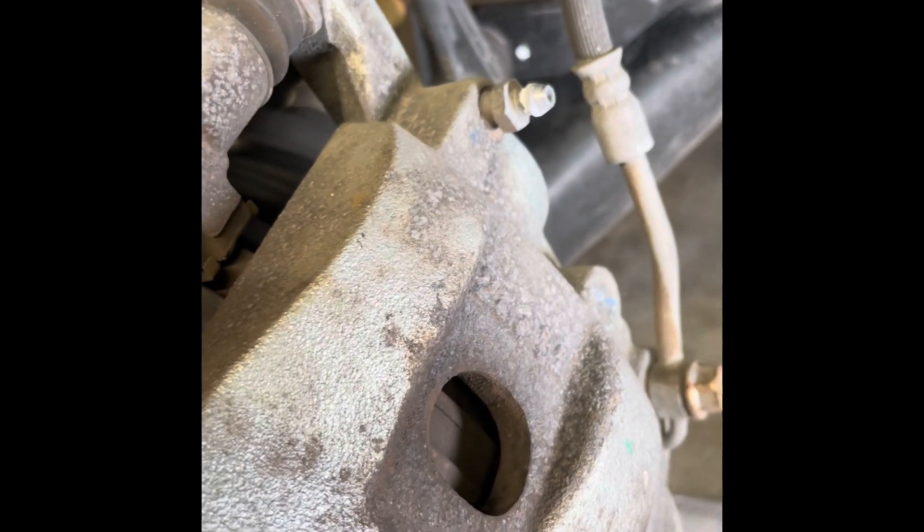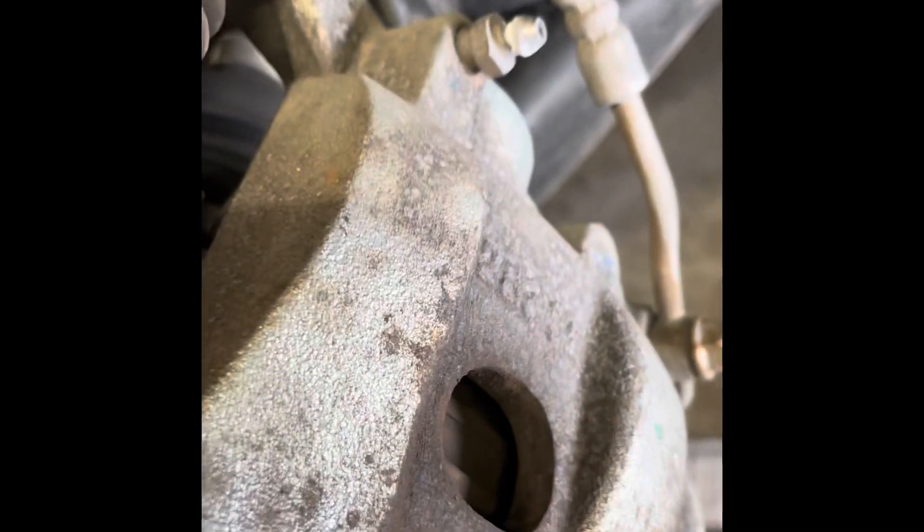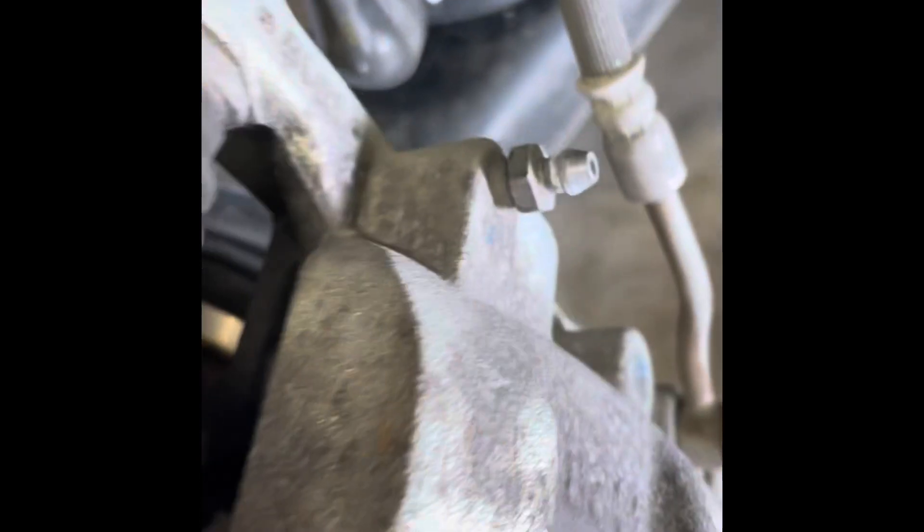A couple of helpful tips: put down some paper or something below where you're going to drain just to help keep your garage floor clean. Also, it's a good time to inspect your brake pads — you can look through the caliper to see the back pad looks pretty good, and the front pad still has some decent pad on it as well. Another tip: before you put your hose on, you'll want to break loose your drain first. As soon as you get it broke loose, get your hose on there pretty quick because it's going to start leaking fast.